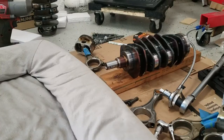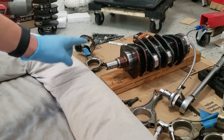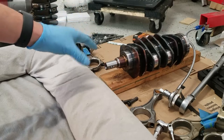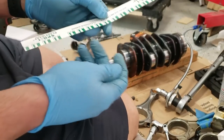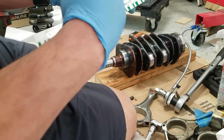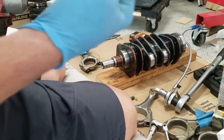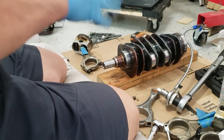So the phone that I'm using to record this died. I got one done. It's plastigauge. I think it might have slid a little bit. It is still in spec. It's about 0.038 millimeters at the thickest part of it. And then the thinnest part is still thicker than 0.051. And the spec for this is 0.055 to 0.025. So I'm within spec even with it sliding.